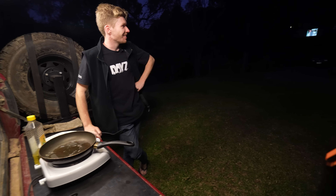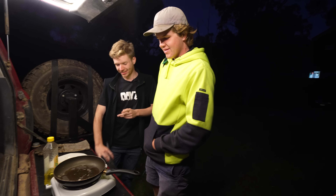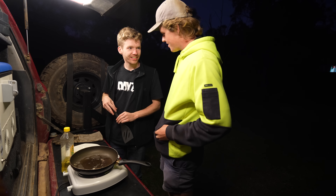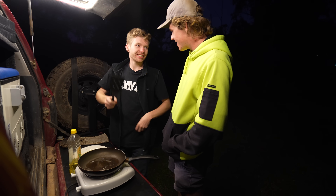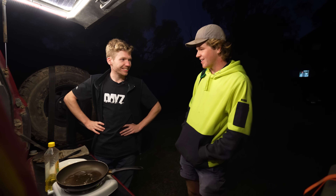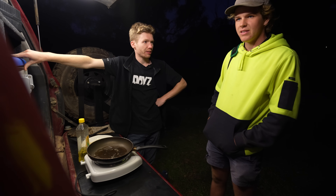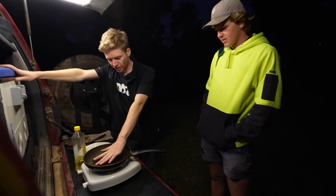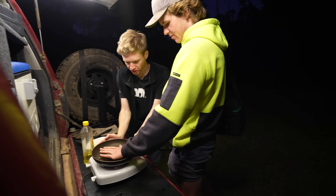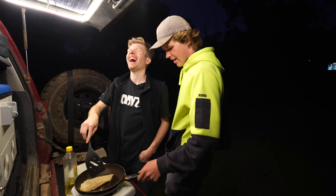The voltage is really tanking now. We're doing a full shakedown test — hot plate going, travel buddy going, fridge going, everything's going. It's not really getting warm — drawing that and the travel buddy is probably like 46 amps combined, plus the fridge and the big light. I'm just wondering if we can do it with the hot plate, but it's just not looking like we can. I think the issue is it's just not efficient — it's losing too much heat around the sides.